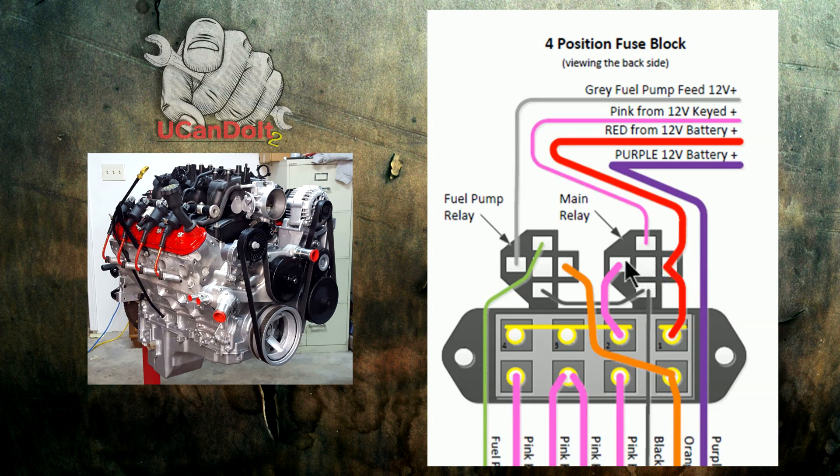Let's talk about our main relay. It has always-hot coming across — if the relay is turned on that positive goes across and powers this pink wire. Inside the relay, it's always grounded on one side through a black ground wire coming from the engine. When you put the key in the ignition and turn it on, you get 12 volts coming down the pink wire. As soon as you have 12 volts on that pink wire and a good ground on the other, this circuit closes and electricity can come through and feed the rest of the system. That's how the main relay works — by turning on the ignition you're providing power to fuses two, three, and four.